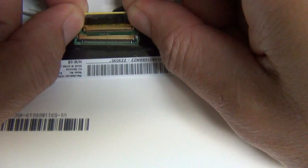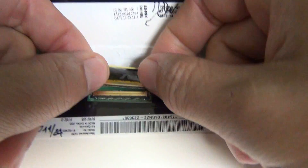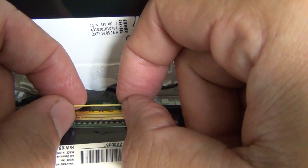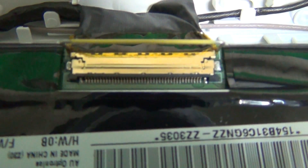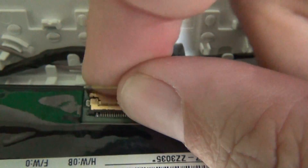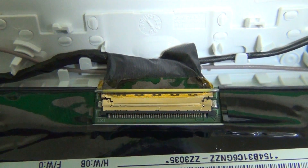I'm going to reconnect here to show you what a properly connected screen looks like. We position the connector into the connector and snap it back in. You'll feel — but not hear — two clicks when it's properly engaged. Pause the video right here: this is what a properly connected connection should look like. There's no gap in the seam between the two sides of the connection; the two sides are flush with each other.